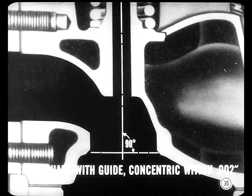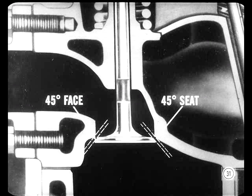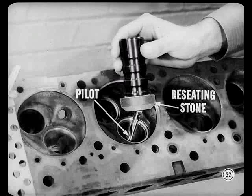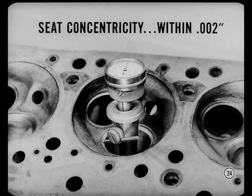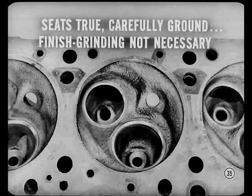I finished facing the valves, and none have sharp edges at the margin. Now we're ready to true up the valve seats — this is a precision operation. The seat must be square with the guide and concentric within two thousandths total indicator reading. The angle of the seat must be the same as the face angle: 45 degrees on this V8 engine. Be sure to use the correct size valve guide pilot with a reseating stone; a pilot that isn't self-centering can turn out a seat that's off-center. Only a light grind is needed, so support the weight of the tool to take a very light cut. Seats must be true within two thousandths total indicator reading.